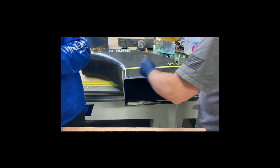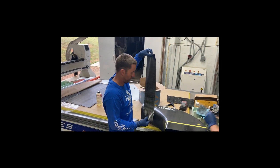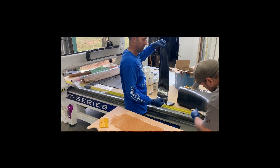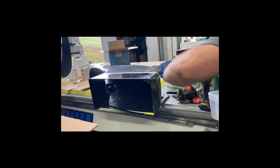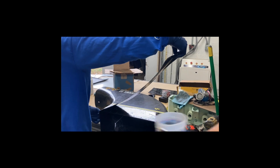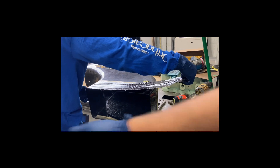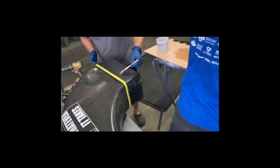He's just getting it wet so that when I lay this other sheet on there, it'll adhere really well. We've got this completely permeated with resin, and then we'll just begin to lay the carbon here on the scoop and go around the whole base to really repair this damage. I'm doing two layers, so it'll take a little bit of time. We're just going to lay it on here, take our time — and at the same time we're trying to hurry up because I have to be back at the racetrack. Just lay the carbon down nice and neat. You're trying to keep that grain straight so it has a good look to it. You don't want it to be all crooked and wavy.